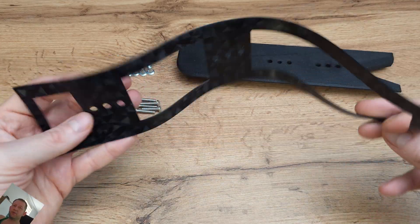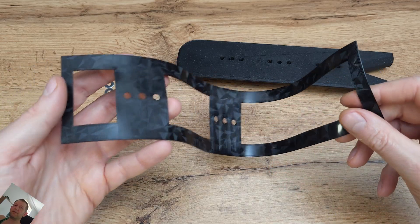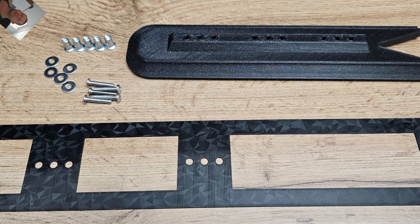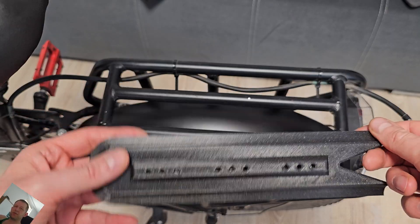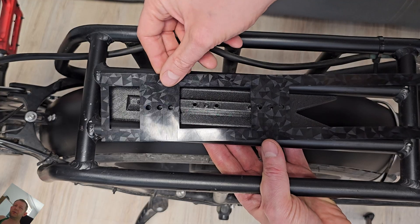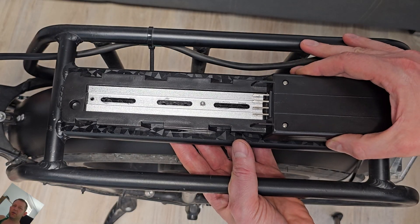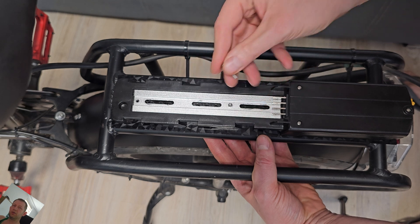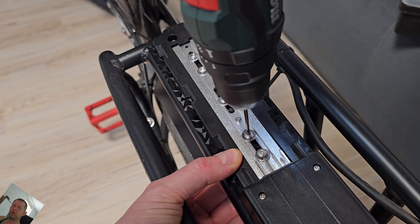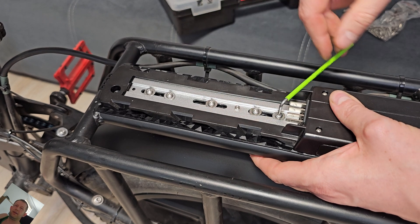For the second part you can use flexible filament — it will prevent scratching and keep the battery from moving around due to higher friction. If you don't have a 3D printer, you can find a link in the description to my eShop where I can print those parts for you. Now just screw it down as shown. I use only 5 screws, and after 300km — with 100km off-road — the battery is still in place. I just had to retighten the screws twice, but this idea seems to be working quite nicely because you don't have to drill any extra holes in the frame or do any other crazy stuff.